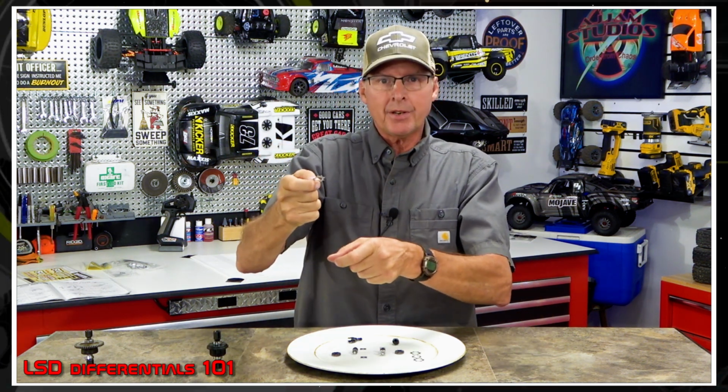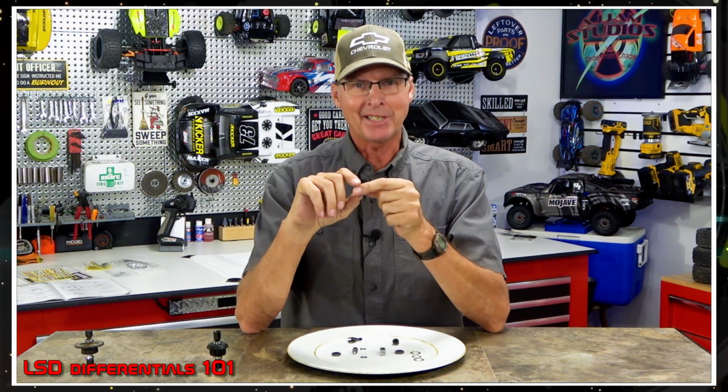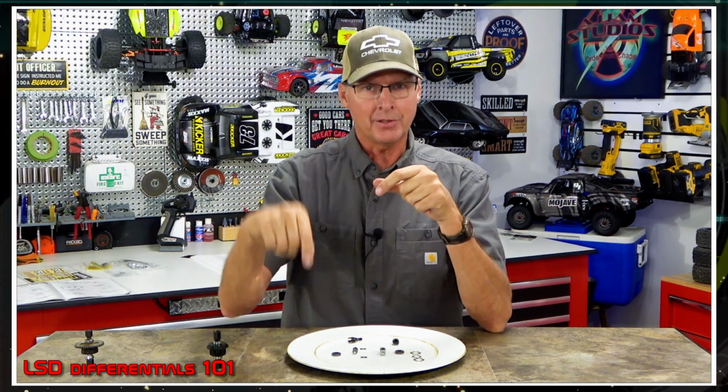Well, I can tell you why. These are punched. So when a machine comes down and pushes the material out of the metal, it smooths the impact side and it makes it coarse on the output side where it dumps it down into the tray. So being punched parts, it gives you a coarse and smooth side. Now that has a weird benefit to it.